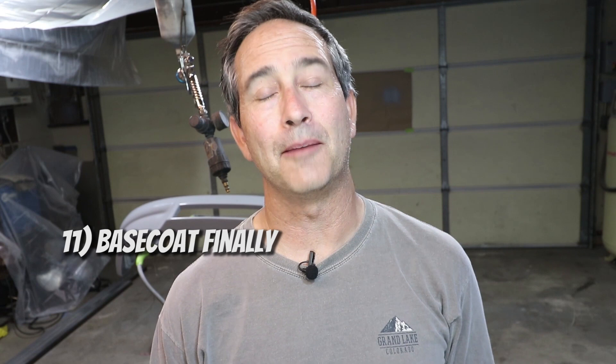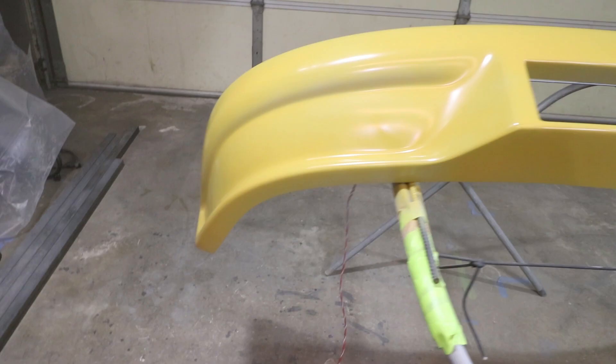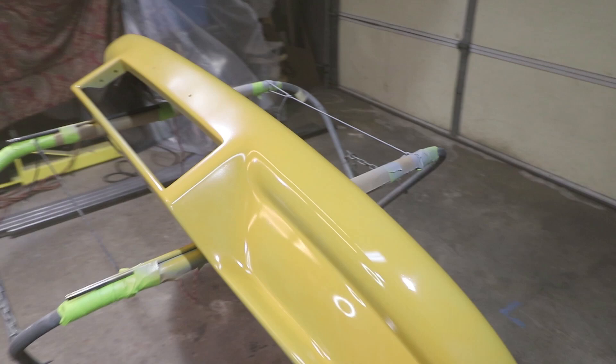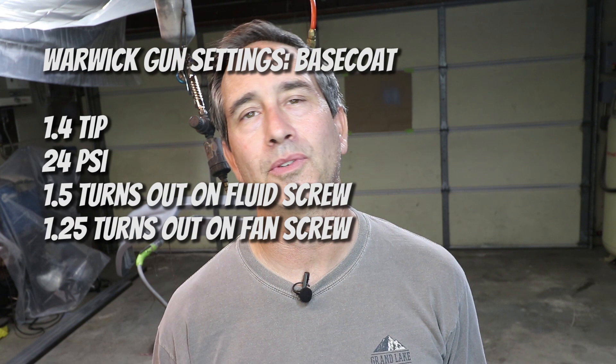All that work — however many steps that was — is very, very critical for a good paint job. Base coat is typically three coats. I like to do the first coat really light, just fog it on there a little bit so you can see the transparency of the primer coming through. Then the second coat is a pretty heavy coat, and the third coat is also pretty heavy. Make sure you've got good coverage — use an LED flashlight and look for any areas that aren't fully covered, and do a fourth coat if you need to. Let the stuff dry between coats using a slow reducer, and let it dry a good hour before you try to put the clear coat on.